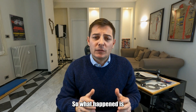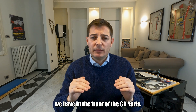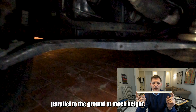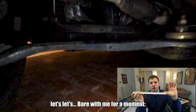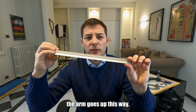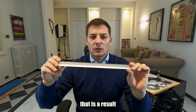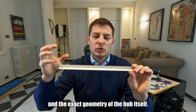What happened is I was looking for a solution to correct the bump steer and camber loss we have in the front of the GR Yaris. If you look at your stock car's front control arm, you will see that it sits already parallel to the ground at stock height. So what happens is that when you lower the car — the car body is on one side and the wheel hub is on the other — when you lower the car, the arm goes up. Being a MacPherson strut coming up to the wheel hub, you have a camber curve that is a result of how the arm is positioned, how long the strut is, and the exact geometry of the hub itself.